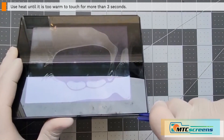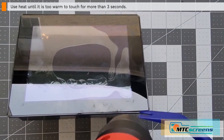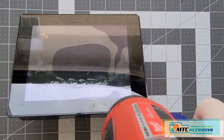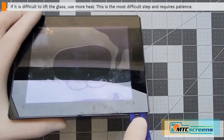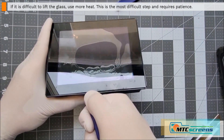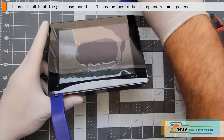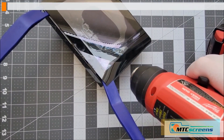At that point, slip your plastic or metal pry bar inside the gap. Apply more focused heat if needed — the pry tool should slip in and cut through pretty easily. If it's not cutting through easily, it's a sign it's not warm enough, so use more focused heat on that section. The logic is to go through a section, warm it up, and continue around. Take it slow and have patience. If you rush and try to cut through glue or tape that's not warm enough, it'll crack the glass.